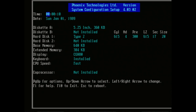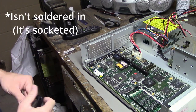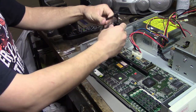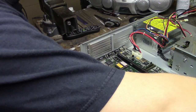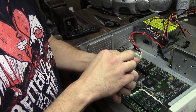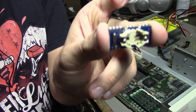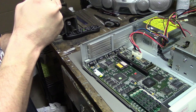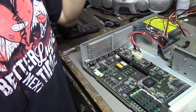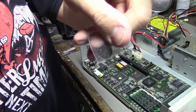I'm just going to assume the clock chip battery is dead, so I'll try the Glitchworks chip replacement and see if that can save our settings. Yep, battery's dead. But at least I know the power supply works and the motherboard works — this is really good news. Let's go ahead and replace that Dallas clock chip. Luckily this one is socketed. Got the Dallas clock chip out, and as a replacement we're going to use the Glitchworks chip. Put that in the socket and put the battery in it.